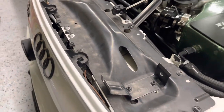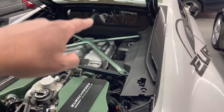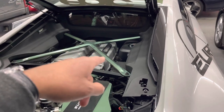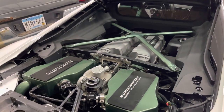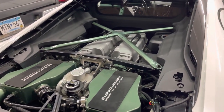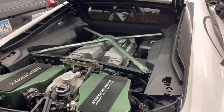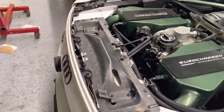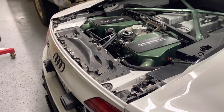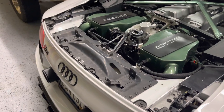The last thing — if you're going from a base to a Plus wing, you have to go into the cab behind the seat where the fuse box panel is, and you'll need to find the fuse for the wing mount. Take the fuse out, and you'll also need VCDS hex to be able to code the wing operation out. There are plenty of write-ups online for how to code that out, so any questions you're welcome to message and ask.